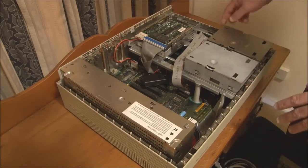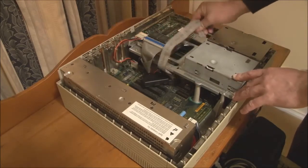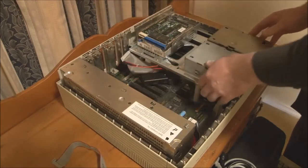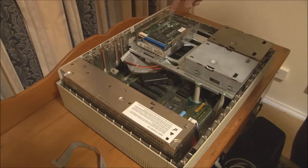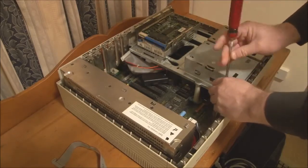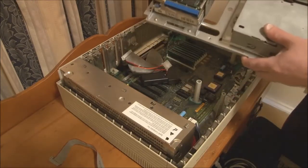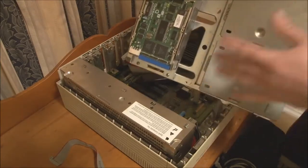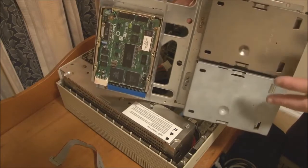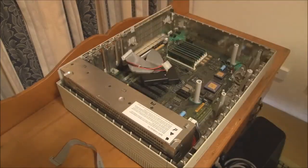Next we need to remove the bracket that holds the floppy drives and hard disk. We'll disconnect all of the data cables — unplug the floppy drive, take that out, and unplug the hard disk data and power cables. What we can now do is take out four screws — two up here and two here — to remove the drive carrier bracket. With the screws removed, we can lift the bracket straight out and it takes the hard disk and floppy drives with it. To remove the floppy drive from the bracket, you simply undo this screw here, and the floppy drive bracket comes off. For the hard disk, you take out these two screws and the entire bracket comes off with the hard disk.